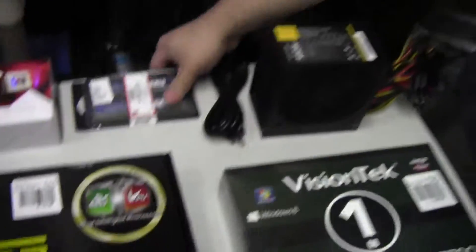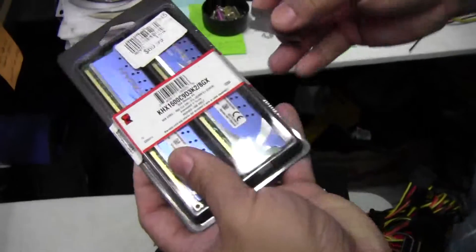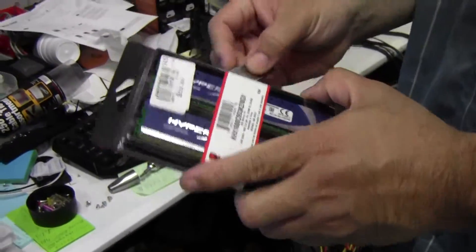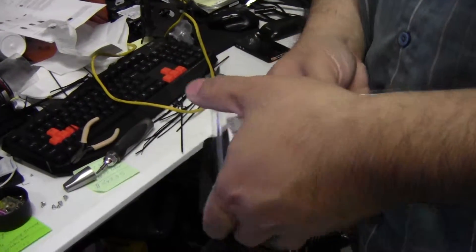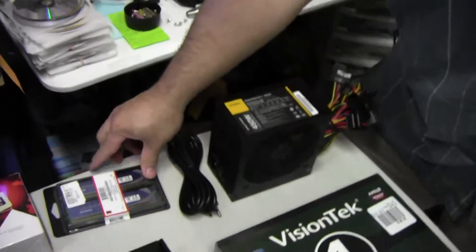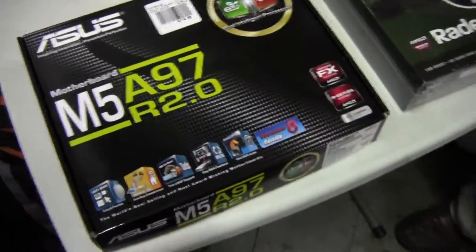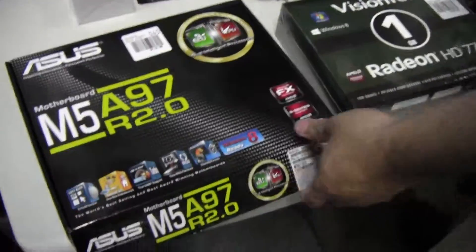They do include the power cord. In this build we have Kingston HyperX — the 8 gig kit, two DIMMs at 1600 MHz, CAS latency 9. We wanted a lifetime warranty unit but to keep it affordable, since RAM has gone up in price, we went with Kingston. You'll want to get 1866 MHz RAM if you can.